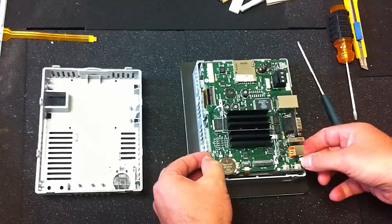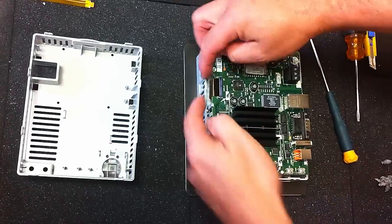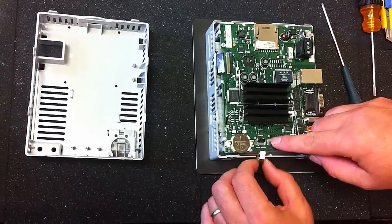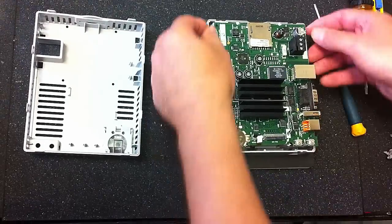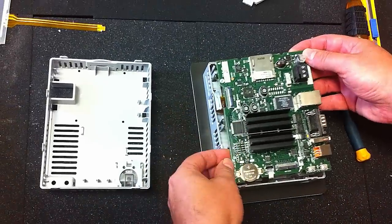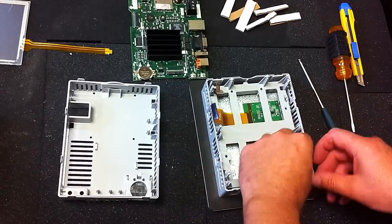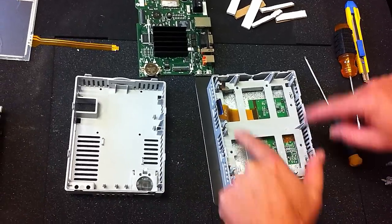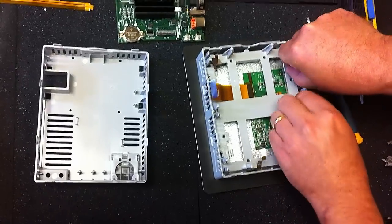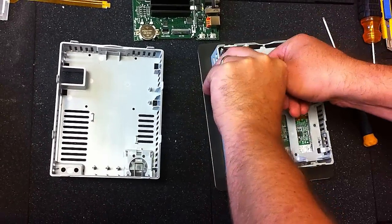The back cover comes off. We lift this little tab up and disconnect the display part. Lift this little tab up and disconnect the touchscreen. There are some clips — pop the computer board off. This is the latest version from Allen Bradley. There are four clips that hold the next plastic piece down. Use your fingers, or if you need to, needle nose pliers will also work.